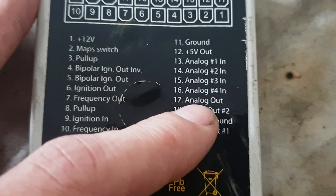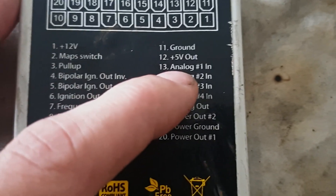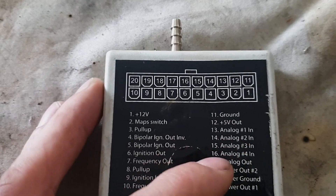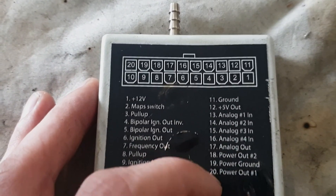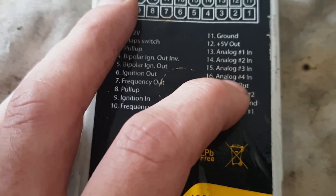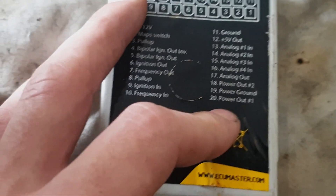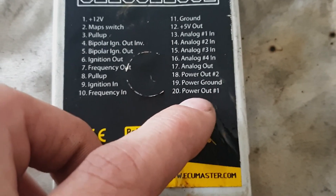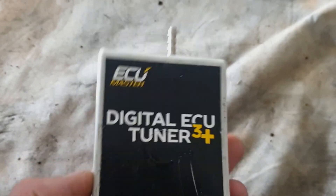But if your vehicle is running a bigger MAP sensor — even one that's sufficient, say two bar or three bar — you can just wire it in through analog two and select the MAP sensor from that. If you choose to use that, you have to use analog input two as the channel for the MAP sensor. Then you've got analog three, analog four, and your analog out. What I did here is — with the stock MAP sensor on the Toyota — I've taken the 5 volt analog in, you can program that in the computer from the MAP sensor, and I've gone analog out from the ECU Master DET3 back to my stock ECU. So that's piggybacking it, essentially playing with the signal and putting it back to the stock computer. You've also got power out one and two for driving injectors, so you can use this as standalone if you'd like.